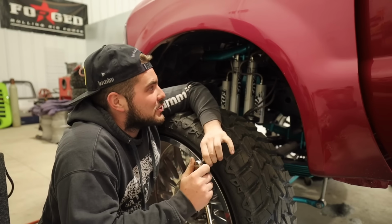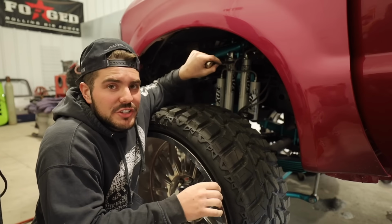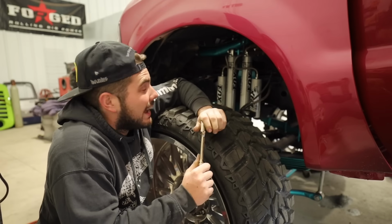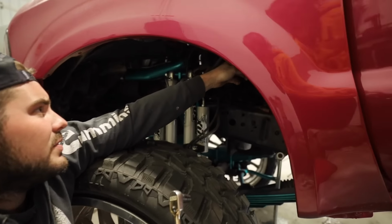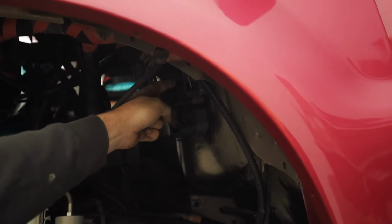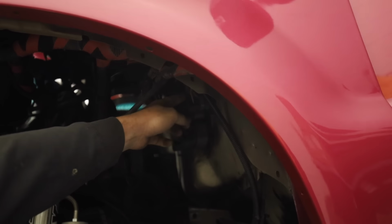Obviously, I'm lucky to still have this truck in pieces. Without these wheel liners in there, you get better access to everything we just did, valve cover bolts, better prying angles on your injectors, stuff like that. But also on the driver's side here, this is the bolt up in here that takes that computer out from underneath the dash, and we'll be able to install the chip. There's a 10 mil right here on this connector.